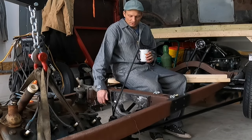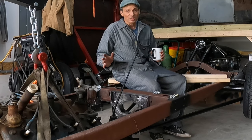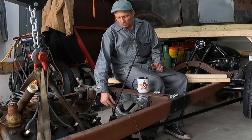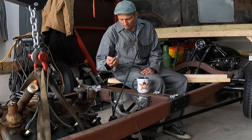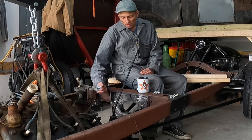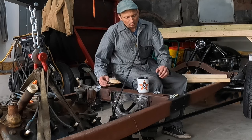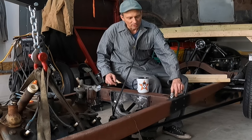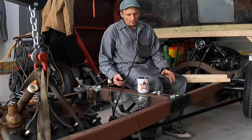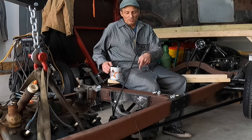We've got our boxing plates bolted in - not the final hardware because I didn't have hardened nuts, so we'll have to fix that later. We've got the real bolts to bolt the transmission to the motor mount but I don't have nuts for those yet. I've already bolted the motor mount loosely to the mount in the frame - I think that's the best way to line this up and then just drop these in to pin it. Next thing is to watch me struggle lifting this engine and trying to get it lined up back here.